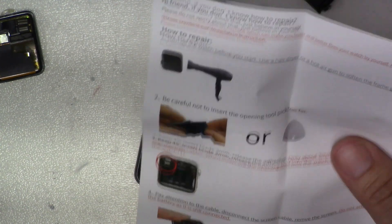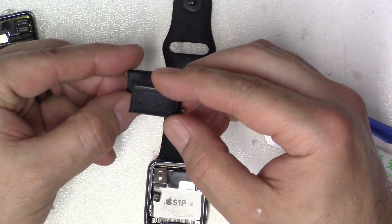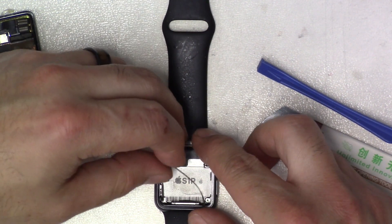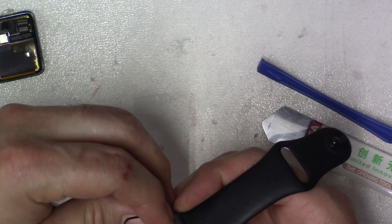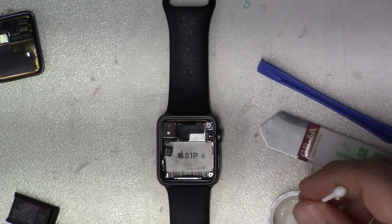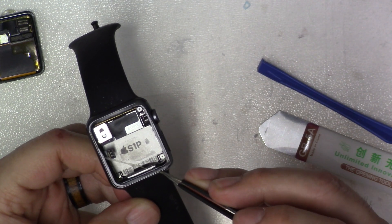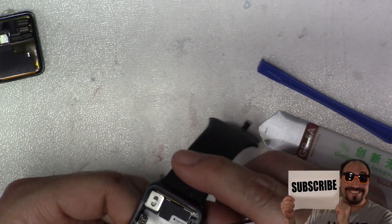I have two of these pads, so I'm thinking that's what they're used for. That's the new battery — old and new. Before we do anything else, I want to put a new rim of glue around this. I'm going to gently peel this force sensor. They thought it was a weather seal in the instructions but it's clearly connected — it's not a weather seal. I've got 99% isopropyl alcohol, which is good to keep around when you're working with electronics. I'll dip a Q-tip and go around the edges to clean it up.